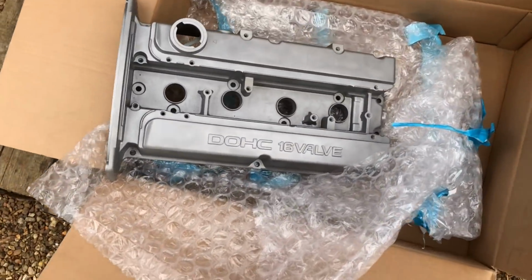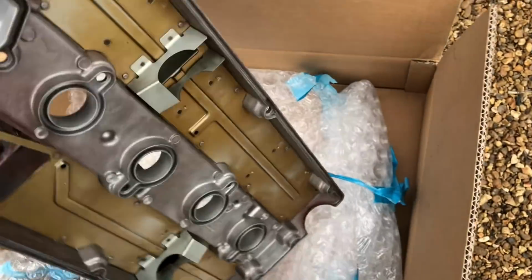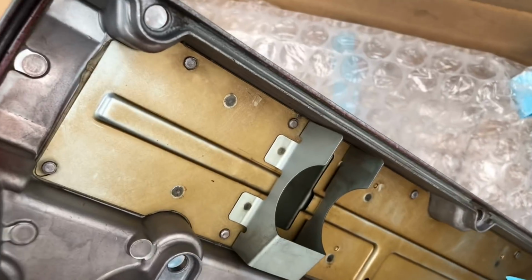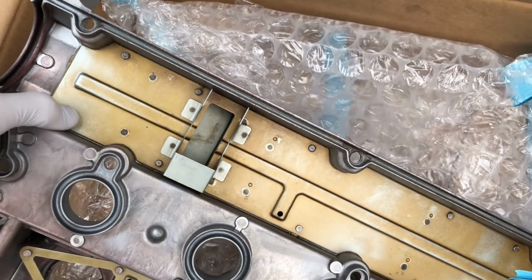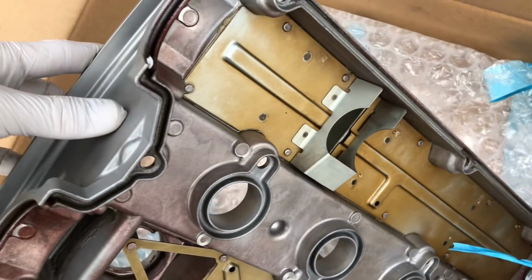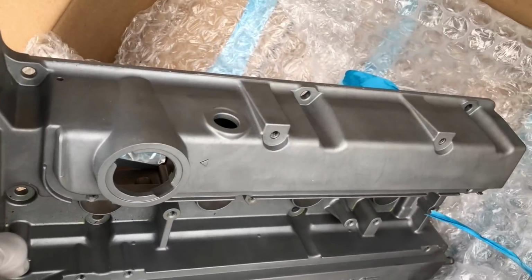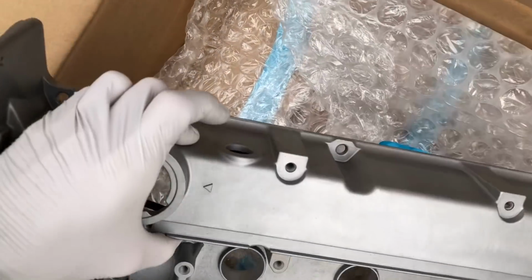So I got one of these and got it bead blasted, sand blasted, whatever you want to call it. At the minute, you see in here, it has baffles in the back, and when they're sand blasted, you get sand that gets trapped behind the baffles. So first, you're going to have to drill out all these baffles before it's painted. Clean it up thoroughly, then get the breather system welded into the appropriate parts, the same parts here and here.